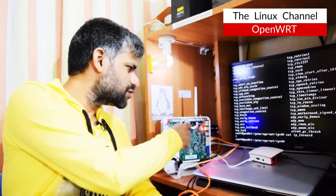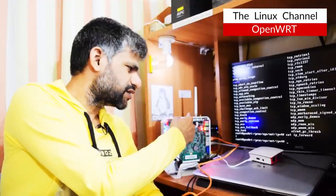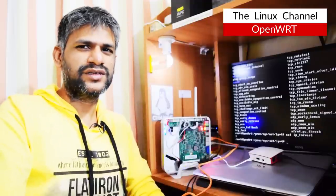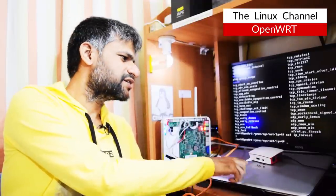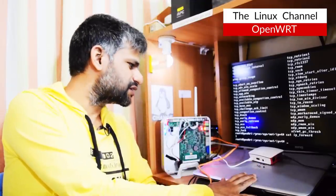And also I have removed that M-SATA, like I said, that 32 GB drive, and I have installed it in this HP laptop, because this laptop has that M-SATA support, versus this Dell doesn't have. This is quite old, versus this has that M-SATA interface. And I just use that laptop for any such casual stuff, or sometimes to do this testing and other stuff.